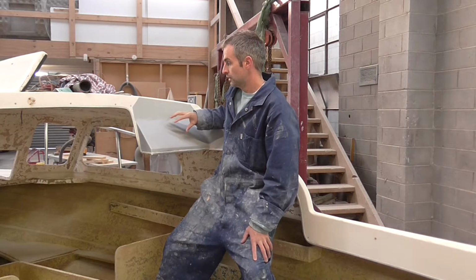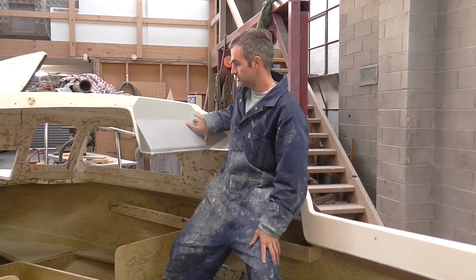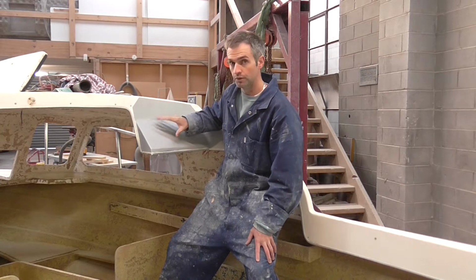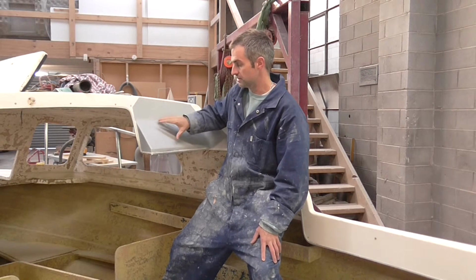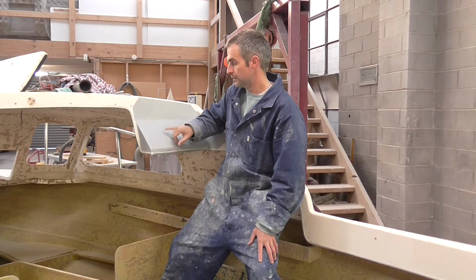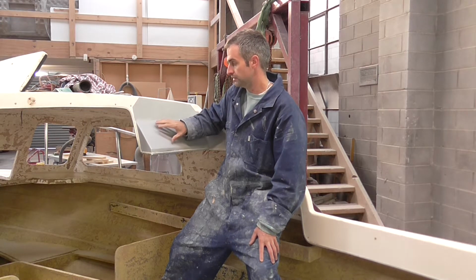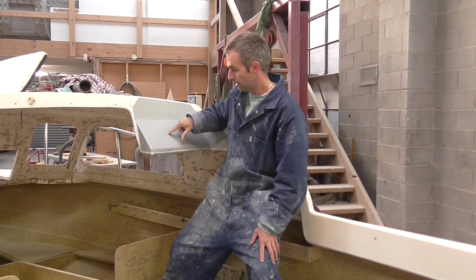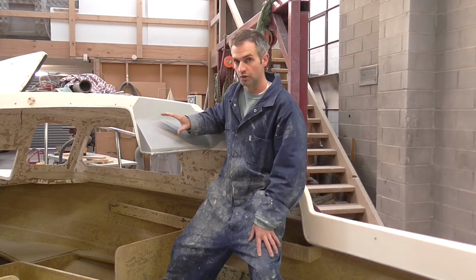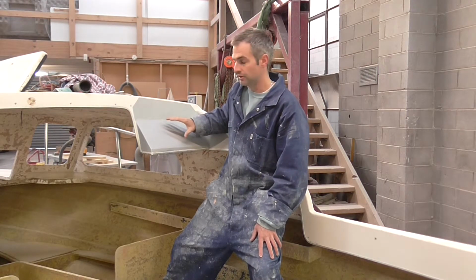so that's a good base coat anyway for us before we do a final coat. What we do generally with holes like this, through this section here, is wood. So wood will replace the holes, fill the holes with wood to ensure that the substance stays the same and the same strength all the way through. Generally what happens is we have to cut the wood to suit the hole, that gets bogged in, and then we spoon out around the hole and that gets glassed over. What you will see later on is I'll show you some footage on the other side of the dash, and it'll make what I'm telling you now a little bit clearer.